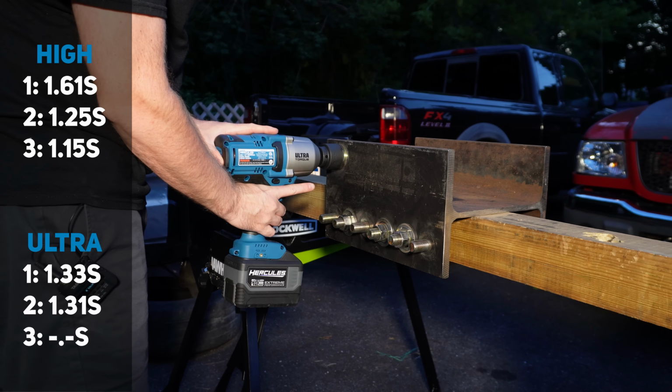Okay, what do we got here? So we got PA6 GF30 plastic. All right. We have a Defond switch here. I mean, it's a nice enough switch. It's not an Omron or anything, but it's nice. It's easy to modulate. We've got a fully conformal coated circuit board down here, so that's nice. So there's the housing. Whoop.